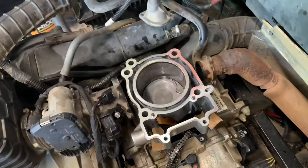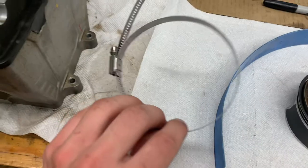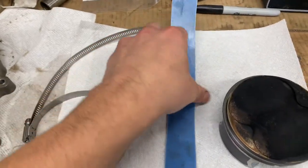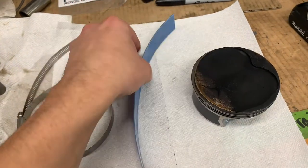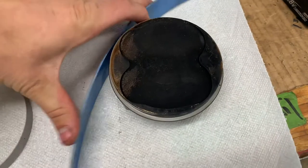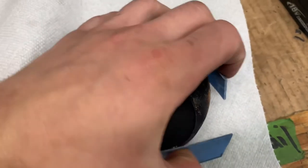For the redneck ring compressor, you're just going to need this — which is like a 12-inch hose clamp — and this, which is a strip of a Rubbermaid bin lid. It's one inch wide because it has to be relatively small to fit on the piston. This is the old piston and I just threw one ring in here so you can see. All you've got to do is wrap this around to get the measurement on the size and make it just slightly shorter than the piston — just like that.